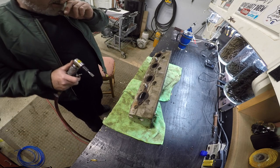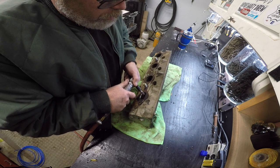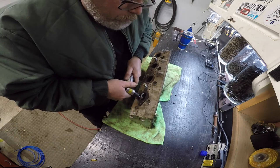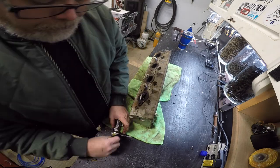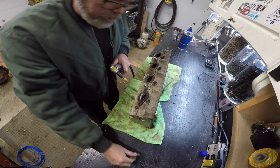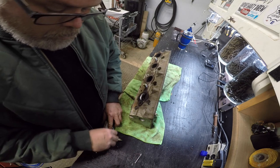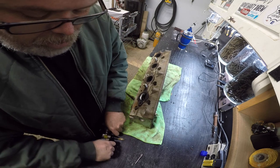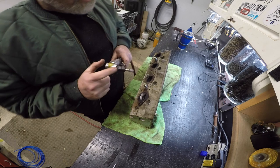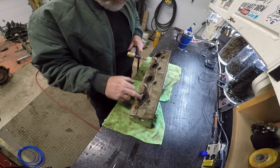Don't worry about stuff getting into the head because I've got to pull the springs and everything anyway so that's all going to come apart. I have a feeling this is an aluminum head — aluminum bit. I'm going to go back to the other bit. I think it's a metal bit so it's getting loaded up real quick. That's a metal bit — I think I bought two metal bits. Now I did buy two metal bits so I'm running into a problem of it gumming up a little bit. We'll have to get another bit but we'll get the roughness down anyways.